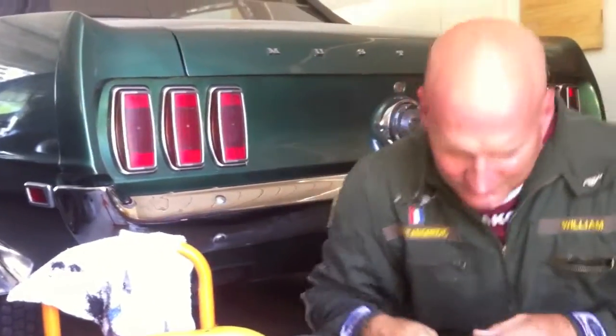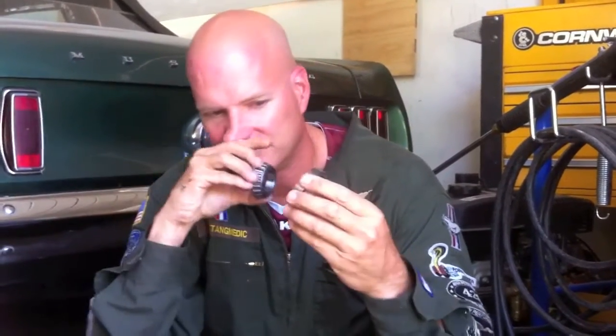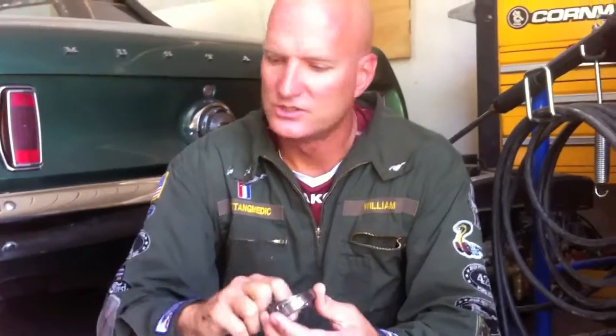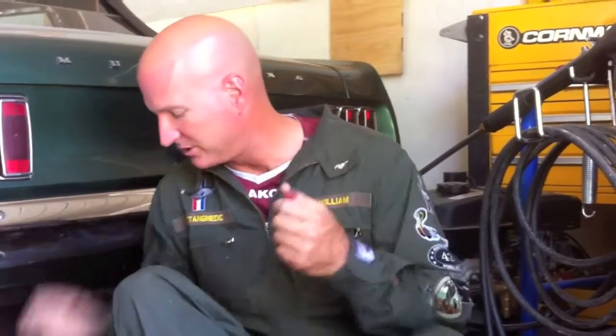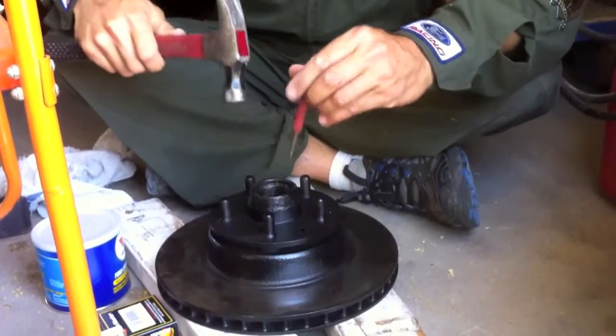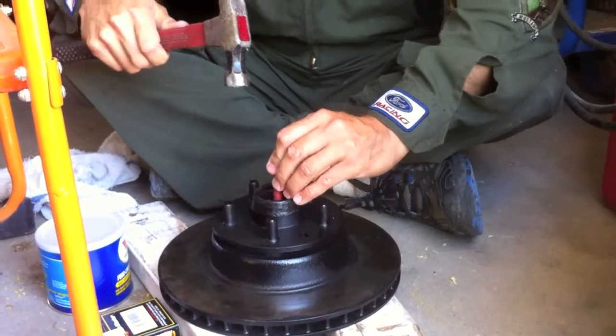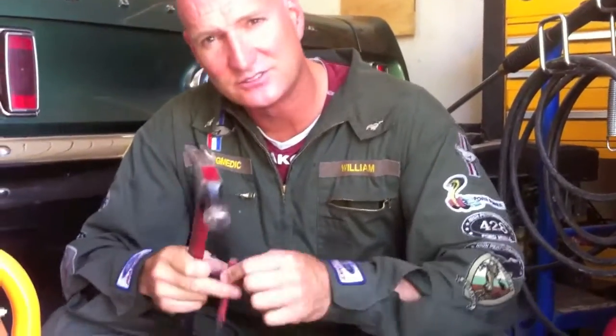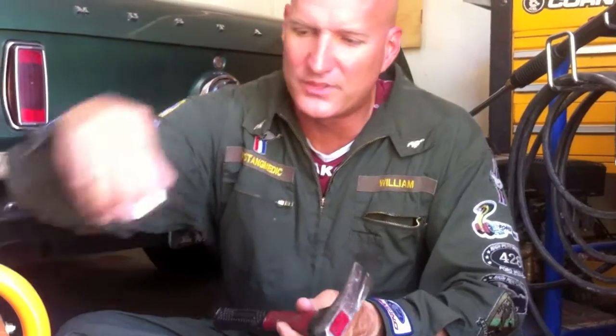Staying focused — what you want to do is get this little piece out when you change your bearings. The back bearing rides inside there and spins quite nicely; it's an ingenious invention. I need a punch and a hammer to get down inside this rotor and tap out this piece. I'm going to do it very evenly, working on the edge and tapping evenly to work it out. Once it's out I'll show it to you, and then we're going to put the new one back in.